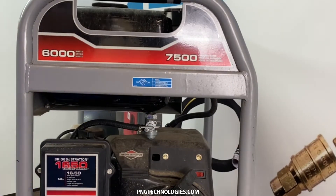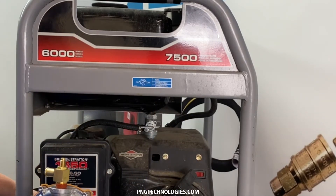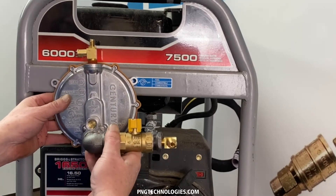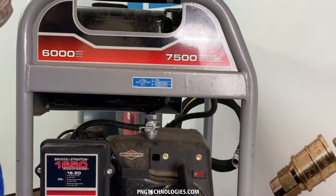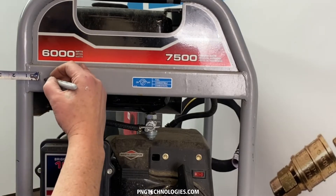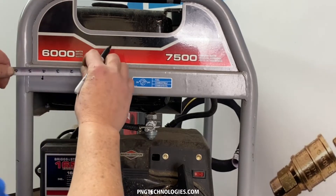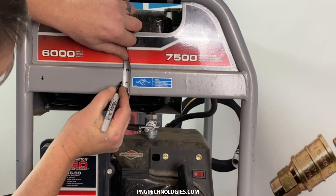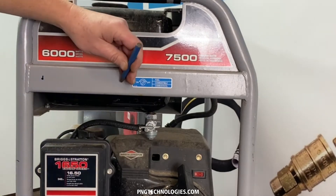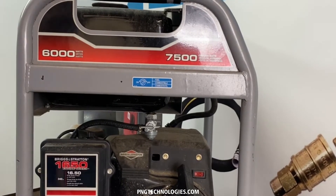Now what we're going to do is go ahead and mount our regulator assembly. You can't mount it over on this side — the exhaust is there. You can't put it down by the frame because your tires are down there. So I'm going to mount it right here. You still have room to be able to change your filter and you'll still have room to pull. From the corner of the frame over here, we're going to mark over two inches and go up one inch from there. Make our mark, then go over five and three quarters of an inch, make a mark, and come up one inch so we got it nice and level. Go ahead and get a punch — this will keep your drill bit from sliding on you — and then we'll go ahead and drill those out.